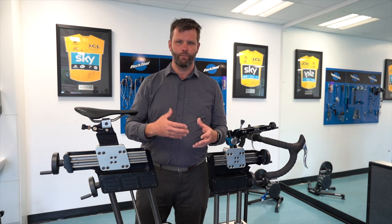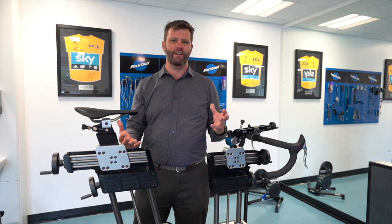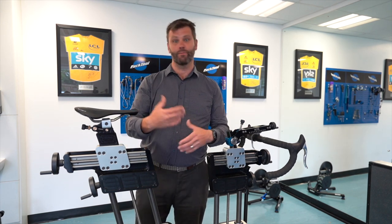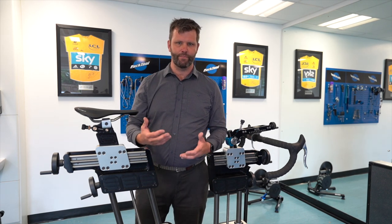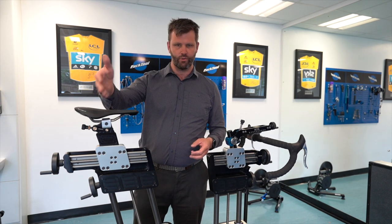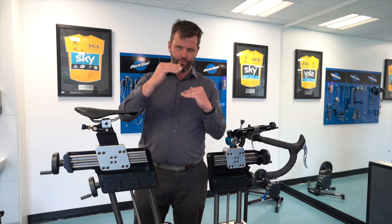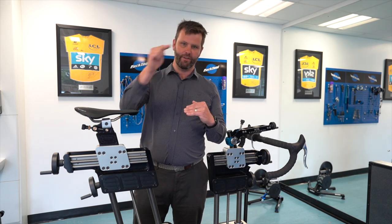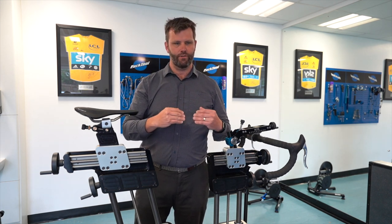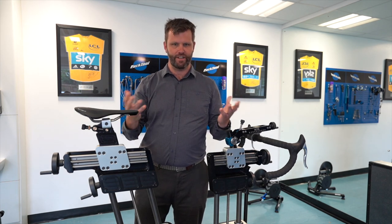The third instance is that human beings, as I've often said, are all asymmetrical. So if you know you have an asymmetry — maybe from an accident, a broken leg, or a leg length difference — and you're starting to get problems on the bike thrown up by that, for example unilateral hip drop on one side or knee pain on one side, consider reducing crank length. If you make the circle you pedal smaller rather than bigger, it's easier to control and easier to do, and it doesn't make your asymmetry drive those problems as much as a bigger crank length would. And those are the examples.